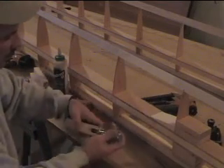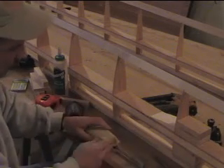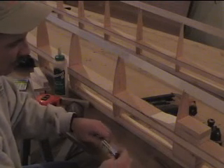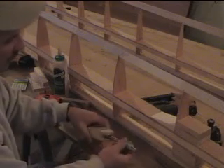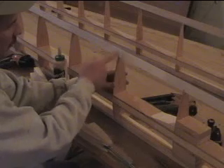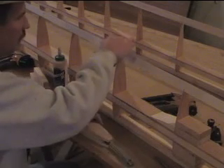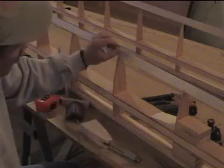When this slides forward and backward, it will be embedded inside the nose of the flap — and you can see it's threaded. That will make up the distance; we just thread it in. If I want the nose to come out, it's going to push the nose out, so we thread the rod back in to bring the nose right back in so we can fine-tune the gap.